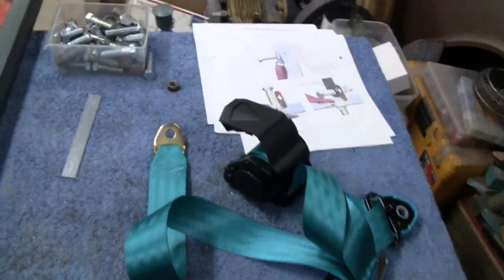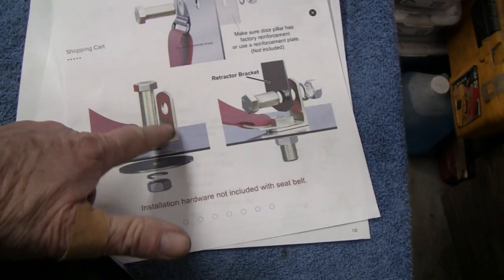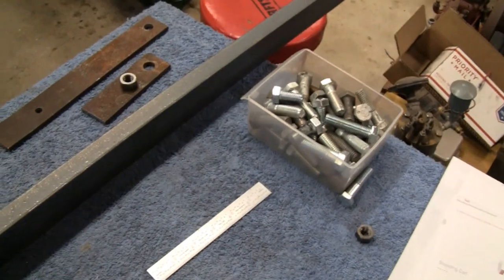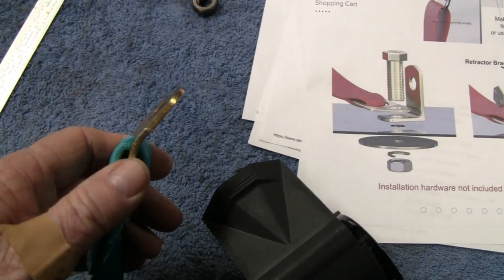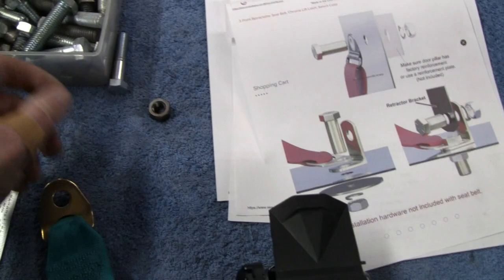It's the next day and I guess what we'll do is make an angle bracket. You've got a little angle bracket here that holds the shoulder harness, and it holds the bottom to the bottom of the truck, so you need a little angle iron there. I had this piece of two inch angle iron laying around — it's three sixteenths thick. Everything they have is eighth inch steel, even on this retractor. So everything I'm using is either bigger and thicker — I'm using half inch nuts and bolts, and they use seven sixteenths. Everything I'm using is stronger.